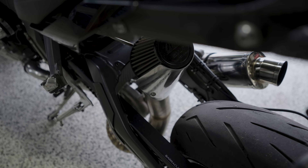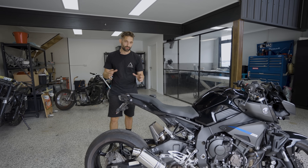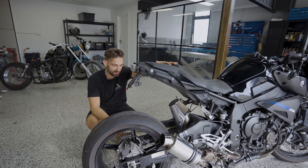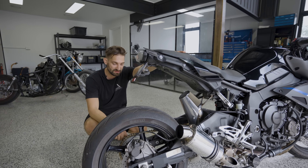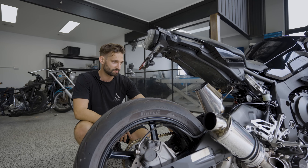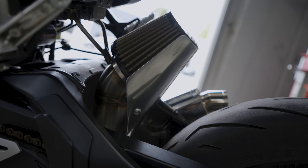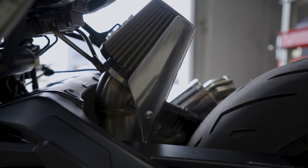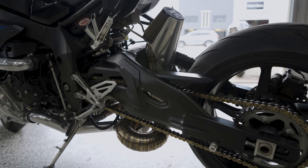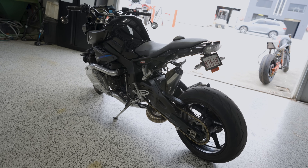Before we get into more engine specifics, you'll notice underneath the tail here there's an intake — something that Dylan fabricated to feed the turbo. We fitted a really large DNA pod filter underneath the tail. We were able to fit this in between the rear tyre and swingarm because Cassidy had already put on a six-inch swingarm extension — a big billet piece that moves the rear wheel right back. We've plumbed up a three-inch pipe with a bunch of pie cuts, which you'll see on this side — we'll get you a nice close-up of that work — coming up to the big DNA filter, linked to the frame as a mount.